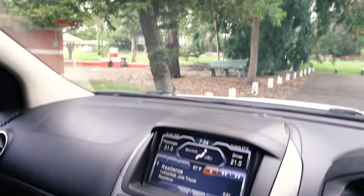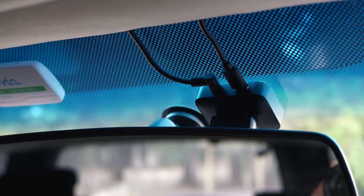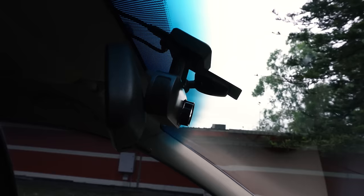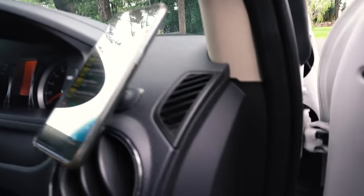Let's talk installation. This camera installed very neatly. You can see the mounting bracket just behind my rear vision mirror here. We've got our connection powering the camera and also our rear camera connection as well. Moving around the front, you can see it's really awesome to be able to hide the camera behind the rear vision mirror. It just minimizes the obstruction to your driving, and it does mean we can route the wiring above the windscreen behind the A-pillar trim, and then it can duck down through the dashboard to the fuse panel.